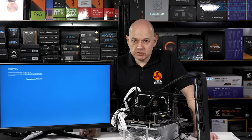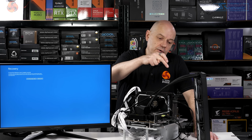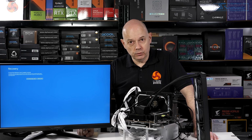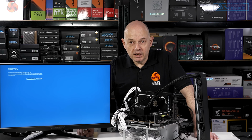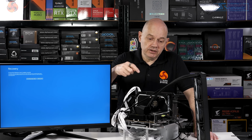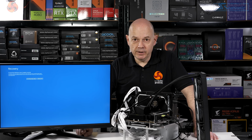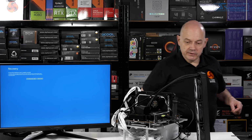And I'm sure you'll hear this story from a great many other people, but the essence of the thing is I have my graphics output connected to my graphics card. If you're building a new PC, surely that is what you too would do. And that is where I made the mistake. You are supposed to connect to the graphics output on your I/O panel, your DisplayPort or HDMI, using the IGP in the processor. Let me just try that now live.